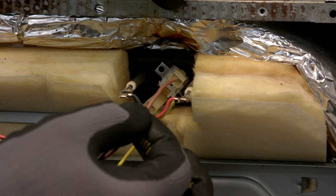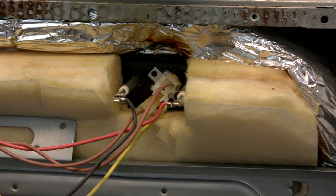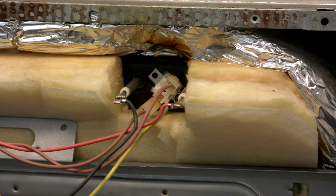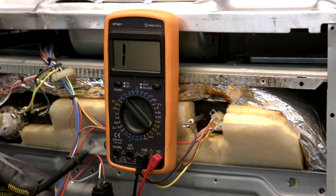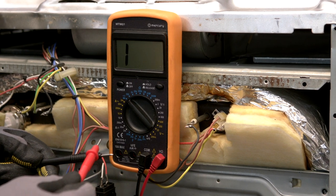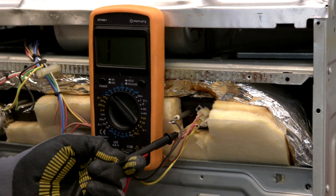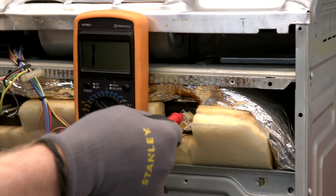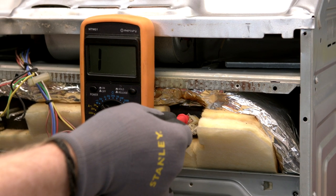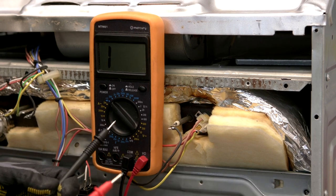There should be a direct electrical connection between these two brown wires. To check that, I'm going to use a multimeter on a low resistance setting. I've attached the multimeter so that you can see there is a connection between the two probes. And if I check the thermal cutout itself, you can see that there is no reading from it at all, which means that it has failed and it needs replacing.